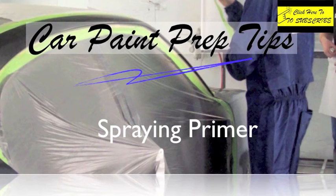And then whenever you start applying the primers, self-etch, that's generally used real light coats. You don't want to put that on too heavy because it has that acid in it. That could bite into your paint and cause lifting problems or something like that. So be sure and put that on 1 to 2 light coats.